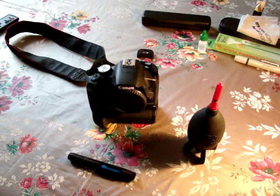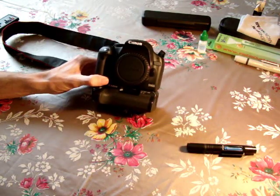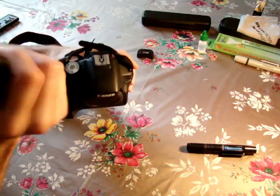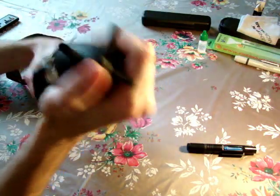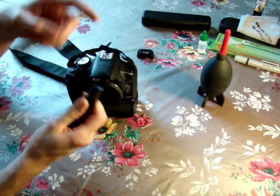Now I'll show you what I do when cleaning the camera body, which I generally do before cleaning the sensor. I've pre-hoovered this area to make sure the table is clean, and I'll probably give it another quick hoover before cleaning the sensor since dust may come off the body. I leave the camera closed up, switched off with the body cap on, and just go over it with the rocket blower around the camera body to remove any bits of dust.